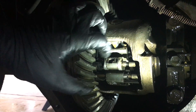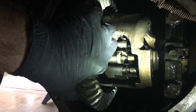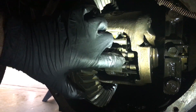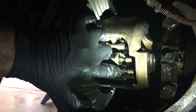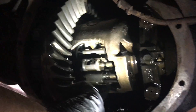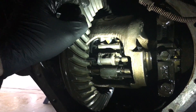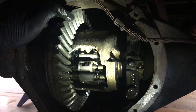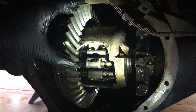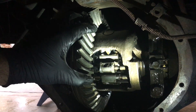That would be good if it still works as intended, because it would eliminate wear on the clutches while in the open position. So to paraphrase, I just bent this spring from here around here, putting more tension on that spring and more tension on this weight. I'm going to put some gasket maker on the housing, put the cover on, fill it up with oil, and put some miles on it. I'll report back as to whether it works or blows up — and if it blows up, I'll throw a TrueTrac in here and keep going.